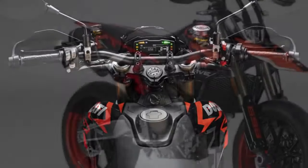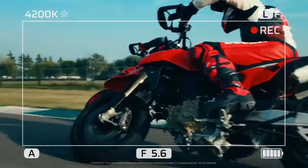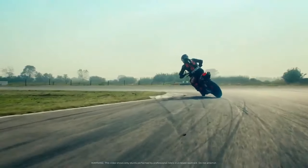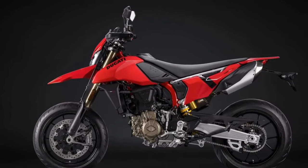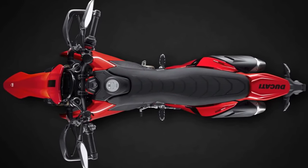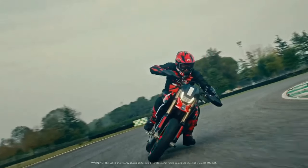Notably, over 70% of the maximum torque is available at 3,000 rpm, with over 80% accessible between 4,500 and 10,250 rpm. The inclusion of a Termignoni exhaust reduces weight by 3.3 pounds while adding 7 horsepower. Weight reduction was a significant priority during the design phase, evident in features such as magnesium engine covers and an aluminum cylinder sleeve akin to those used in the 1299 Superleggera. The total engine weight stands at 98.3 pounds — commendably light, albeit two pounds heavier than the claimed engine weight for competitors such as KTM, Husqvarna, and GasGas.